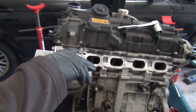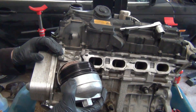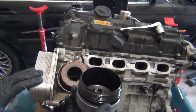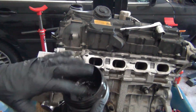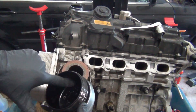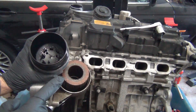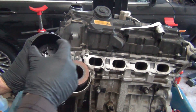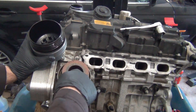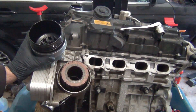What are you looking for when you're doing your oil change? You want to check to see what kind of debris you have, and actually I already found a problem with this particular engine. Do you see something right here? The insert is missing. This may have contributed to this engine's failure. Without this insert, there's a sleeve in here that's part of the cap that has an o-ring that seals this passage — you can have oil pressure issues which can lead to failure in your engine.